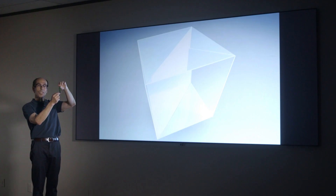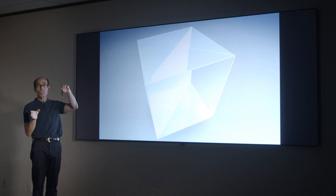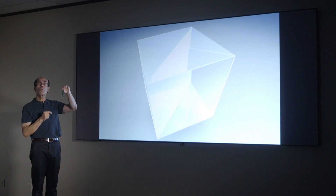This is what an LCD chip looks like in front projection. This is called a transmissive chip — light goes right through it. This one happens to be 1080p, and that means there are 2.2 million little pixels in this tiny area in the center. The ribbon cable has all of the wiring to electrically control all 2.2 million pixels at all times.